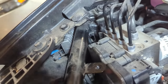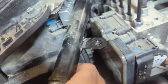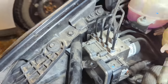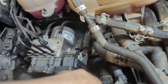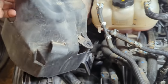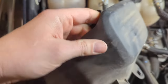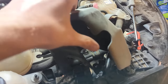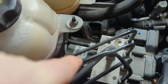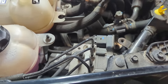Be careful not to drop the cover that covers the hole — you don't want it falling somewhere you can't reach. I've got it back on there; there are arrows on it telling you which way to turn it. Once that's on and covered, grab the ABS module cover again — it'll take some finagling, but you can see how it's supposed to fit with the cutout and the metal prongs.